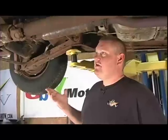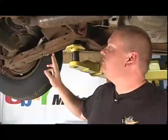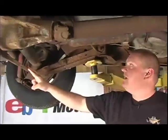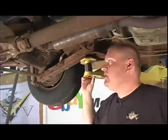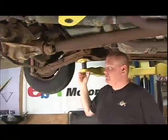It came with the FE2 sport suspension package, which included these boxed lower rear control arms and a factory rear sway bar, and also these upper supports to keep the control arm mounts in place. And then the rear axle is a 10-bolt GM G92 code. It's a 3.42 posi rear axle, as evidenced by the original posi tag.